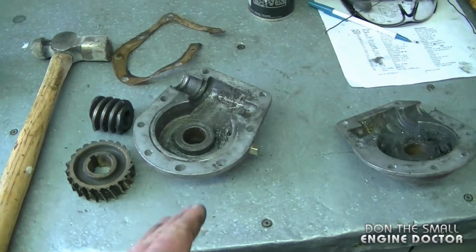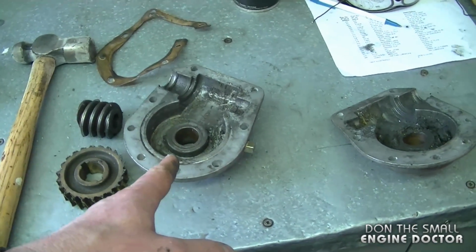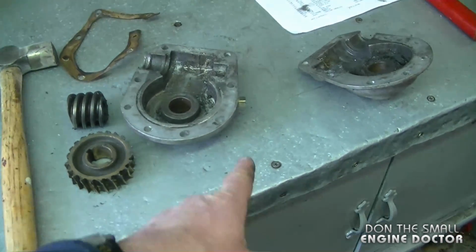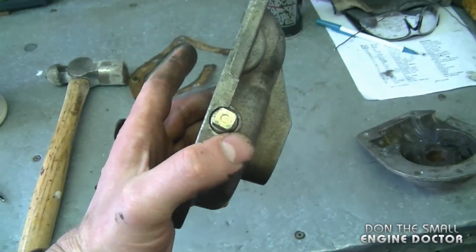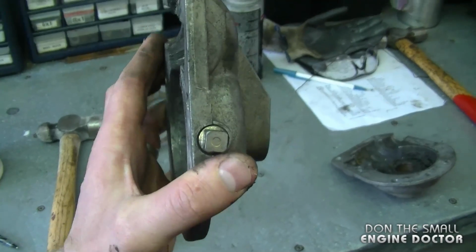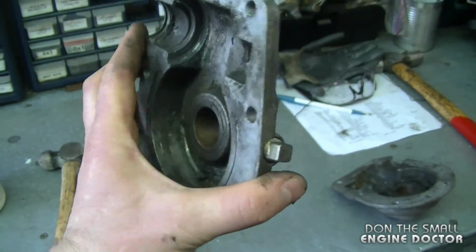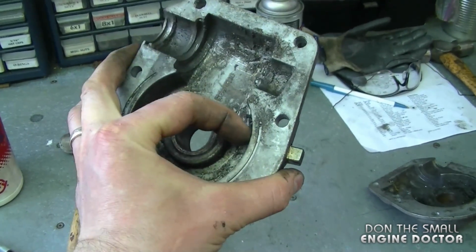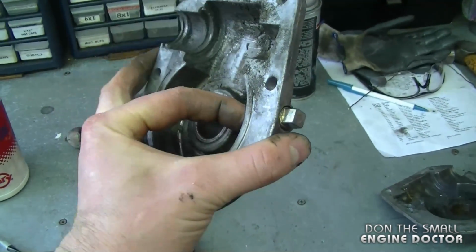Now in some snowblower auger gearboxes, they don't have grease, they have gear oil. So if that's the case, then just add gear oil through the plug. The way you know on those snowblowers if you have enough oil is that when you take the plug out, you put oil. If the oil comes back out, there's enough oil. You don't necessarily have to fill it right up to the top here. They usually recommend to only fill it up to the plug.